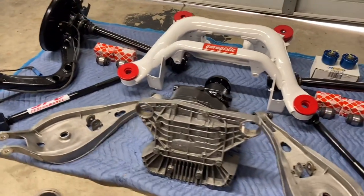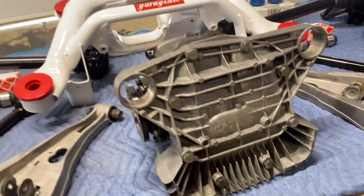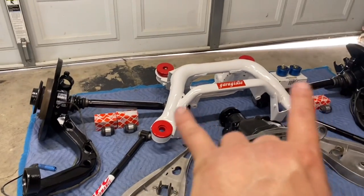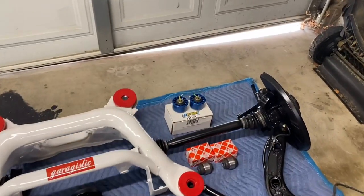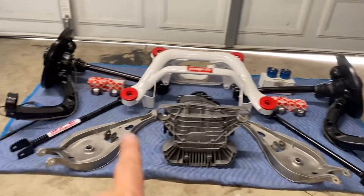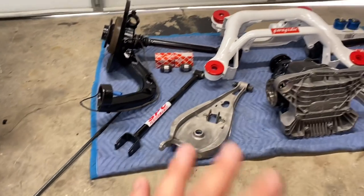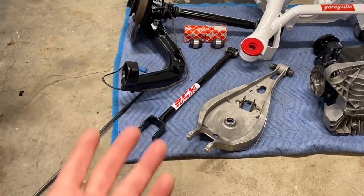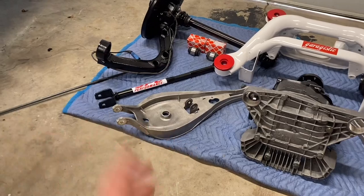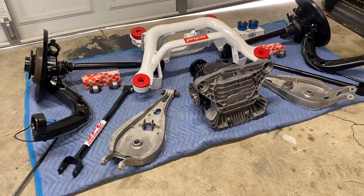It came out a little too glossy for my liking - this was semi-gloss, they didn't have any matte. I wish the diff cover cleaned up a little better; it kept some residual grime and a weathered appearance. It was the best I could do without painting it - I like that raw metal look. We went with all new Garagistic subframe bushings, Turner monoball R-tabs, new Febi ball joints all around - upper outers in both positions left and right. I got new SPC lower camber arms. I was going to go with Turner lower camber arms, but seeing as they're kind of the weak point in the rear end if you hit a curb, it doesn't really make sense to get the best ones when they're more of a toss-away part.